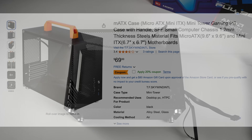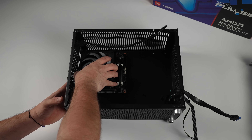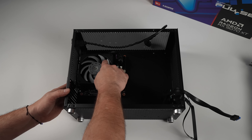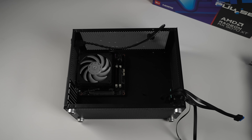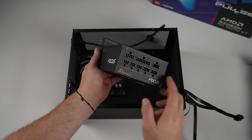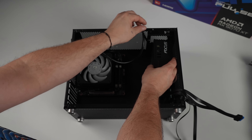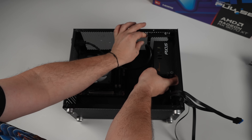When I originally purchased this a couple of weeks ago, there was a 40% off coupon, and that's the big reason I got it. This Mini-ITX setup is going to fit right inside this case, and we've got enough room for a full-size GPU. To power everything, I went with the Seasonic Focus 650W fully modular power supply. It's an SFX form factor, so I'll have enough room to put my GPU across the bottom. This board doesn't need any special power supply — you can use ATX, Flex, or SFX.